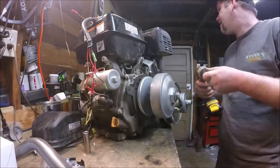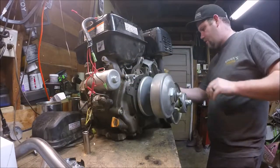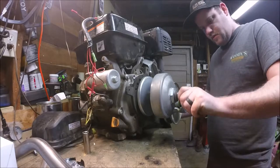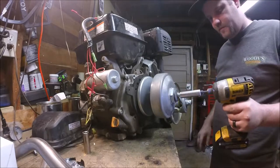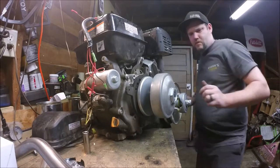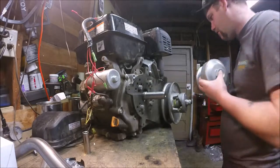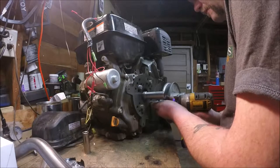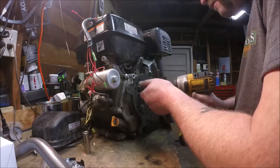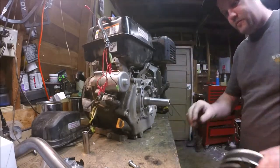We're going to go ahead and take that torque converter off first and foremost, and then take the side cover of the engine off and start removing the governor. The torque converter comes off just like it went on. If you want to see a detailed video on how I installed this 40 series torque converter on the 420, I'll put the link in the description. First, take off the bolt for the pulley on the crank using a DeWalt impact gun, then the pulley and spacers slide off. The last thing to do is take off the four bolts going through the plate and threading into the engine side cover — then that torque converter plate just slides right off.